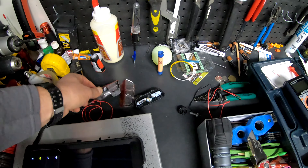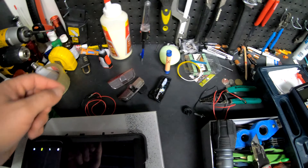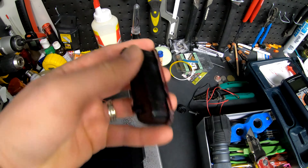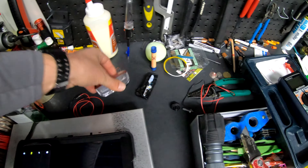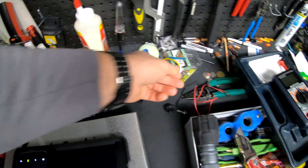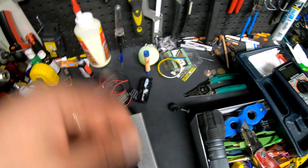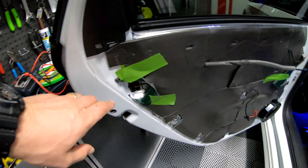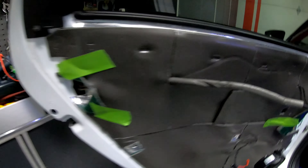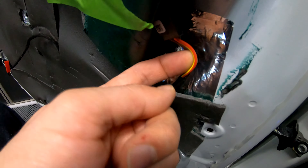One of them the LED completely died, and the other one, as you can see here, fell apart. So I'm simply using super glue to glue these two parts together. This wiring came with little pins which you have to take out. I already removed the pins on one end, and this is where I'm going to make my connections — one to the door lock negative and the other to the window power positive, which is red and yellow.